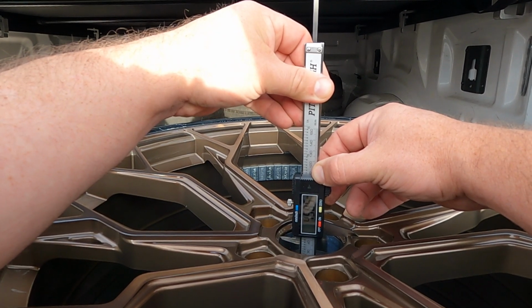It didn't go as smooth as we had hoped. At all. But they're gonna work without spacers. Everything's gonna fit up good. We ran to the house, grabbed a set of calipers. I measured from the hub out to the face, and we figured out one wheel has about 1.3 millimeters less back spacing than the other one. We just flip-flopped the wheels. Everything's gonna be golden. Yep. And they're on, and they look sick. Yep, let's take a look.